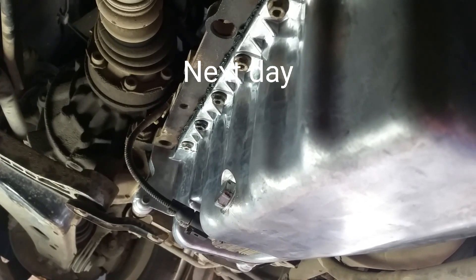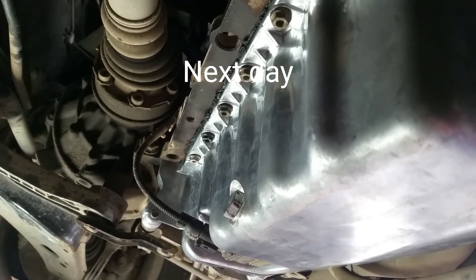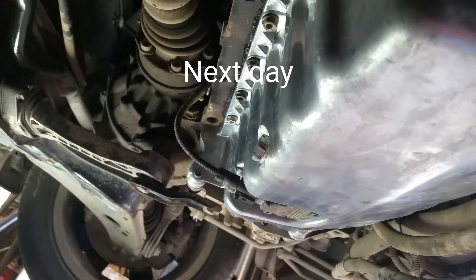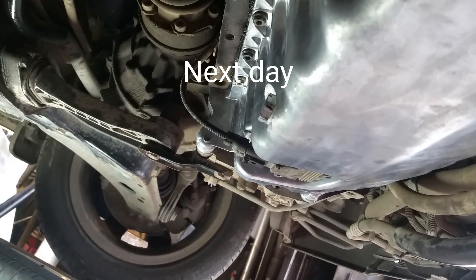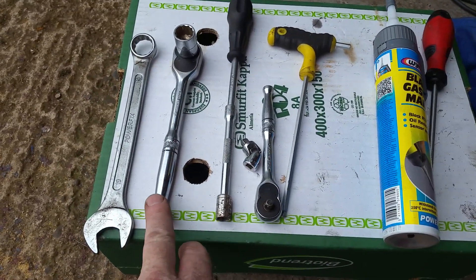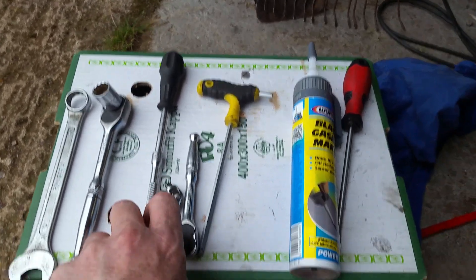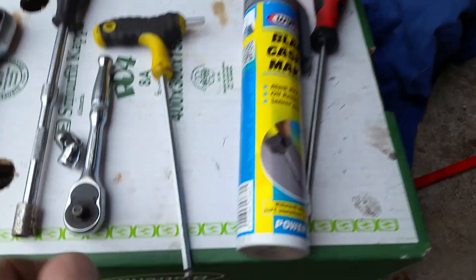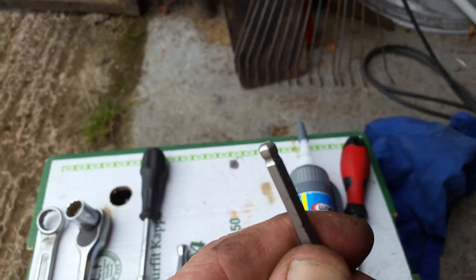I have the engine filled with oil, given the car a test run, and checked right around the sump — all seems brilliant, everything seems okay. It wasn't that difficult a job, to be honest — a little bit of time and patience. Minimum tools required. I'll take the camera out here and show you what tools I roughly used: 19mm spanner for the sump plug, ratchet, 16mm socket and spanner for the three gearbox bolts, 10mm socket, good long extension, ratchet, swivel head, and most importantly these Allen keys with the swivel type head.